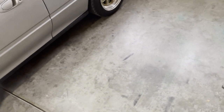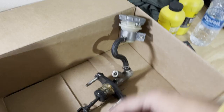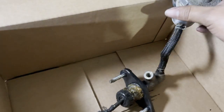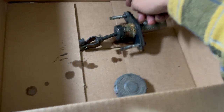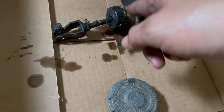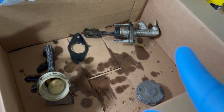You're going to want to be careful when you remove this thing, because you might get some drips on your paint and it's very corrosive on paint. We really don't want to leave it on there for too long. I'm not too sure how to neutralize it, so I'm going to go ahead and spray some water on that just in case. Also you want to avoid contact with skin and clothing - a little late for that now, but better late than never. So we removed the reservoir, the line, and the gasket and separated them from the master cylinder.